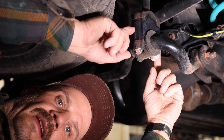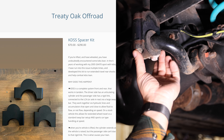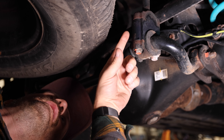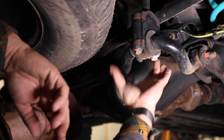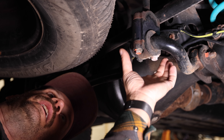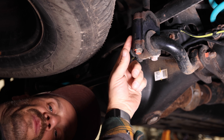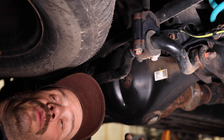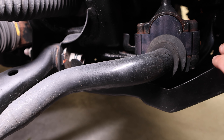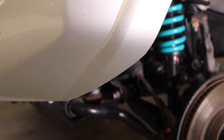This spacer right here is from Treaty Oaks Off-Road out of Houston, Texas. This 4Runner has the KDSS system — Kinetic Dynamic Suspension System — and this spacer brings the rear sway bar back to the factory angle so you don't get that KDSS lean at ride height. These spacers are $200, they're aluminum, and they're worth every penny. As a bonus, with the skid plate spacers from the diff drop kit, the front sway bar no longer hits the skid plate.